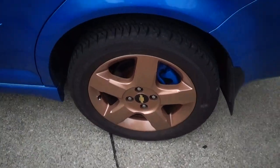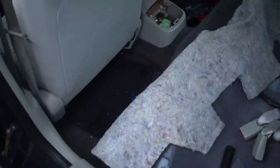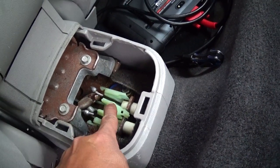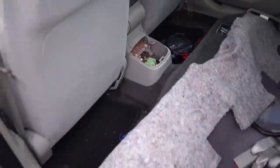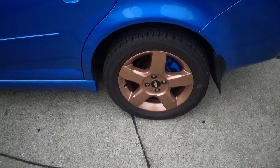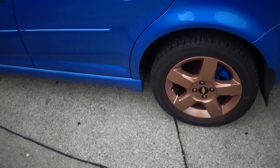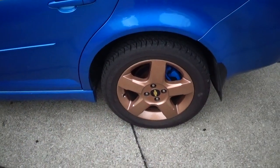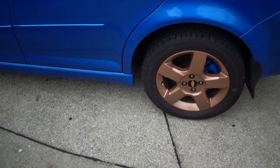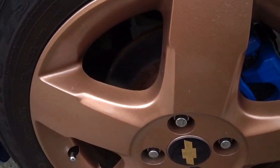I've got it all on there and I think it looks pretty good. The e-brake cable is on but I'm not going to hook it up until I get the other side done. Right now there's a drum on one side and a disc on the other. As it is right now I can tell there's more brake on this side — if you jam it down you feel it pull the car because this brake is stronger. But I don't think that's going to be an issue overall. The pads aren't really seated in fully yet either.